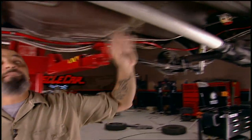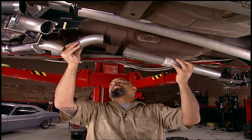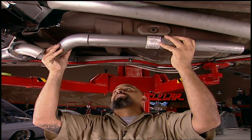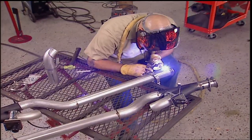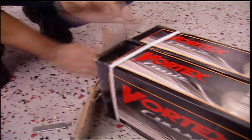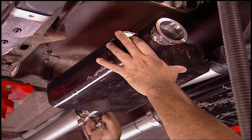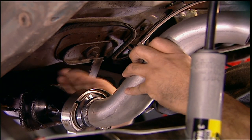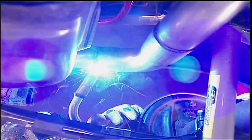I'm using this aluminum tubing to mimic my 3 inch drive shaft that I've got on order. Because I'm using 2 and a half inch exhaust, I've got to make sure that I've got enough clearance to put it all in — and this is doable. Now I'm going to finish these off with some cherry bombs. You older guys will remember that classic round tubular glass pack — well, they're still available, but times have changed. They also came out with an entire line of performance mufflers for every application. These are the new Vortex Series — since the exhaust goes through the middle, these Vortex Series mufflers are reversible, which means they can be installed any way you want.